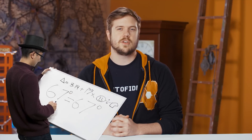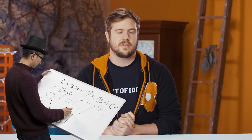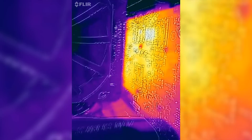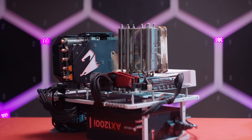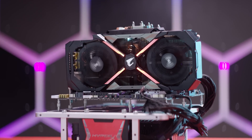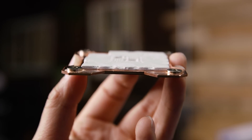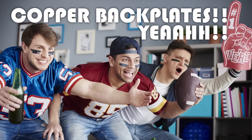That's the result. 67 degrees is not lower than 67 degrees. 67 degrees is the same damn thing as 67 degrees. These results are not different. The FLIR footage doesn't show the cold spot anymore, but as there was no improvement, the core is not less hot. The card is not running any faster. Does the backplate look really cool? Yes. Does it cool things? Maybe the back of the PCB, but not the GPU or anything else that's going to affect performance. It's hard with the tools we have to say whether this is due to poor thermal transfer through the PCB or the thick thermal pad on the copper plate. The card does perform well, so we aren't saying not to buy it — just brace yourself for disappointment if you're a hardcore copper-backplate-for-GPU-cooling-abilities nerd.